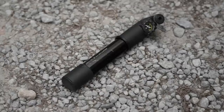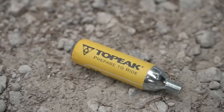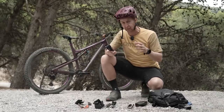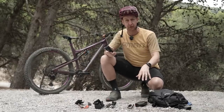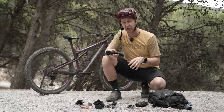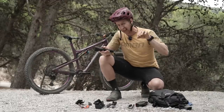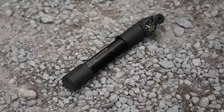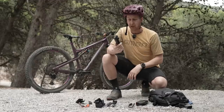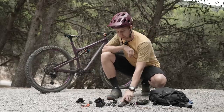A decent mini pump goes without saying. CO2 you should only really use in a race or absolute necessity — a downpour, or if you're risking getting hypothermia. You shouldn't unnecessarily use CO2 cartridges, not to mention the fact that they can mess with some tire sealants; the CO2 by nature can dry up the sealant, so try and avoid those unless you absolutely have to. A mini pump is your best way — this one's a double-action pump with a large volume capability. Always carry a pump with you.